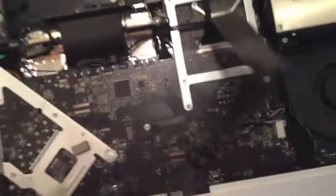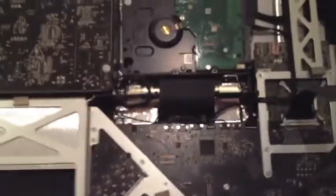The reason these screens cloud up is because they get dust in them — it's a design flaw. You'll see these fans right here are just packed full of dust. Get yourself a can of compressed air and blast those out. Work around the board and keep going until you stop seeing dust coming out. I poured out so much dust from this machine, it was unbelievable. That's the first thing to do before putting anything back together.